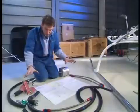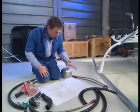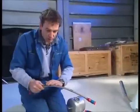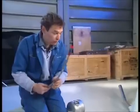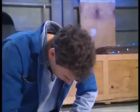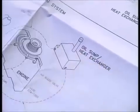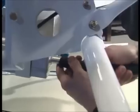There's another pipe — I have no idea where that goes. Now, these are oil pipes — they're very special. They are Teflon pipes underneath a stainless steel coating. Where these come close to anything else, they have to have a protective covering because the stainless acts like a bit of a file, but they last forever. Start with something you know — I know where the thermostat is, so I want a pipe that connects the thermostat and the oil sump heat exchanger. That fits a treat.